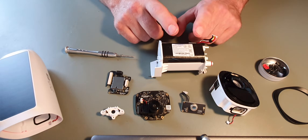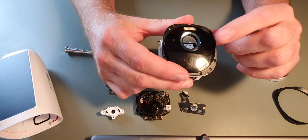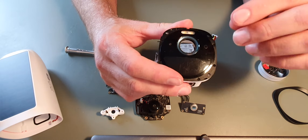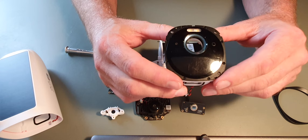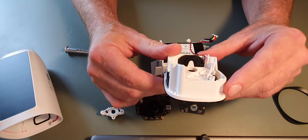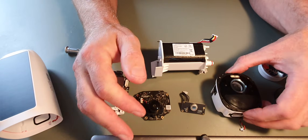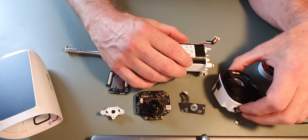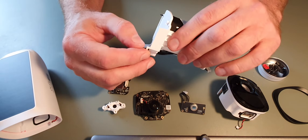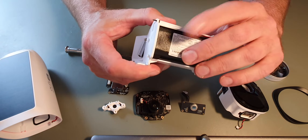With this camera, I don't know if it is the battery with the fault because the symptoms were: the ring on the front, when you press the sync button, did flash blue — which is right — but then it started to flicker red, as if there's not enough power there. A flashing red light is low battery, so no matter how long it was left on charge, it didn't hold any charge. What I suppose I could do is dismantle another camera and try all the other parts in this base to see if that works. But because none of the others are faulty, I don't really want to chance breaking another one. This was beyond repair — it just didn't work.